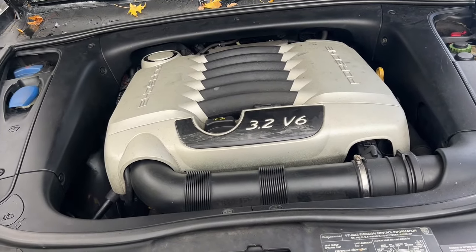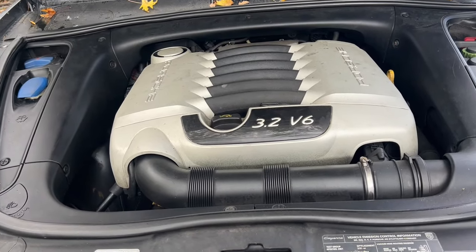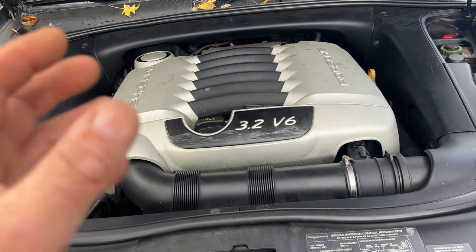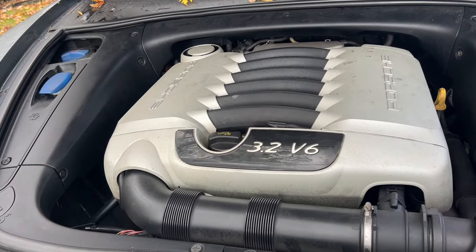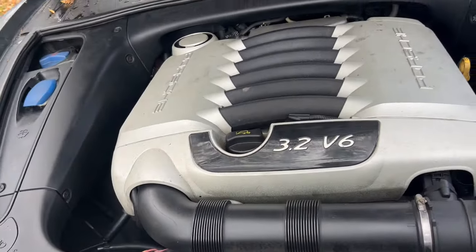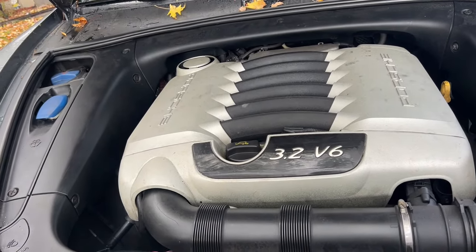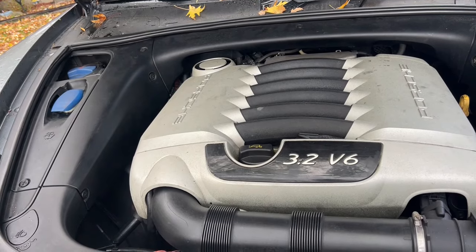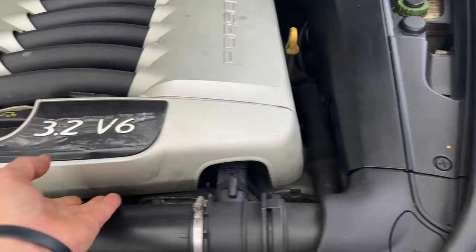The symptoms depend on how bad the valve is. You'll probably get a little chugging when the engine is cold because the valve acts like a vacuum leak — it remains open instead of closed, sucking in fumes it shouldn't. When the car warms up the chugging completely goes away. When cold, it's sucking an improper amount because it's not closing completely, acting like a vacuum leak.